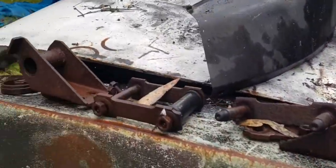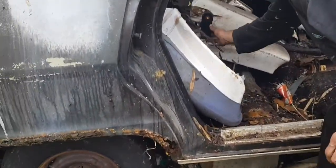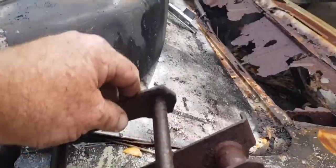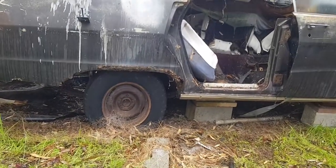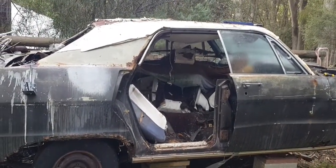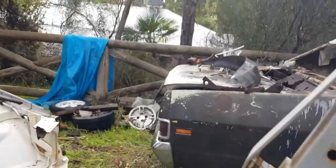We need that diff. I've taken most of the stuff out but could never get the last bolt which sits up against the chassis rail. Apparently you don't take the actual bolt out — you take the whole bracket off from behind because the bolt sits right up against the chassis rail. Another one — beautiful. We just lift the arse end up and it should fall straight out because most of it's already undone. It's just those two front eyelet bolts and she's done. This thing's been sitting here since I moved in — about seven years.